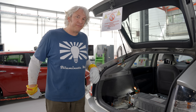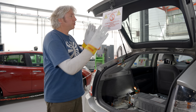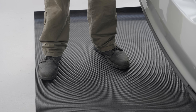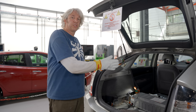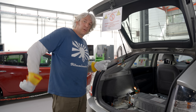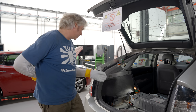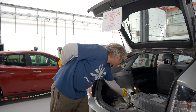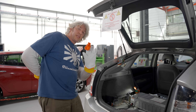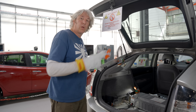Having already donned my safety gloves, there are a few other things I've done to make the area safe. I've got a cordon around the outside, got some stickers to let anybody else know in the area that I'm working on this vehicle, and I'm even standing on a rubber mat. The main thing with electricity is making sure it doesn't go across the heart, which is why I'm wearing the gloves. I'm going to put one hand behind my back, then remove that service plug — just lift that up and peel it out. There we go, that's now removed. I put that along with the ignition key in a safe place so nobody else can rearm everything while I'm working at the front of the vehicle.